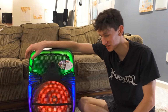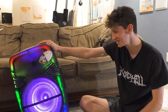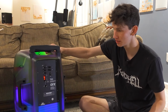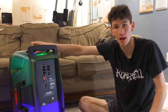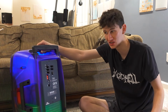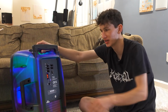You can hear the kicks loud and clear through this guy. The bass, the actual bass, not so great. Because high volume bass needs a lot of very solid construction, the back part of this thing is flexing so much. Especially in the upper low end, like 70 hertz, this thing is buzzing back and forth. Also, it's not well sealed off. I don't even know if it's sealed off because this USB port is breathing. You can feel the air going in and out of that thing.